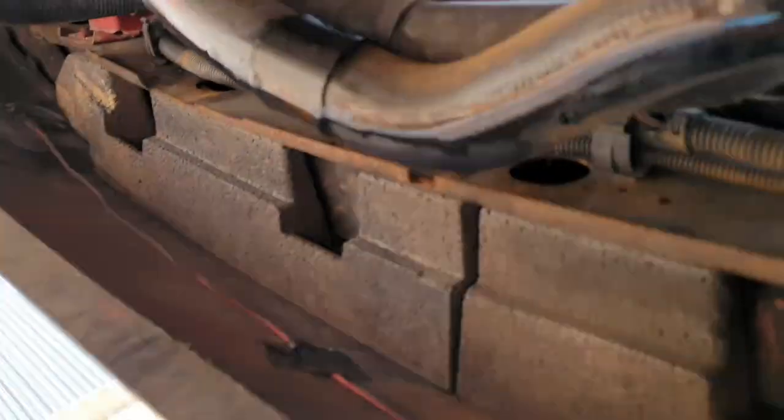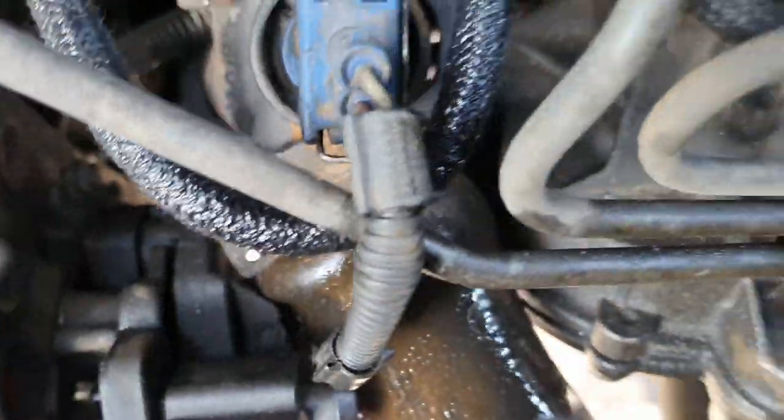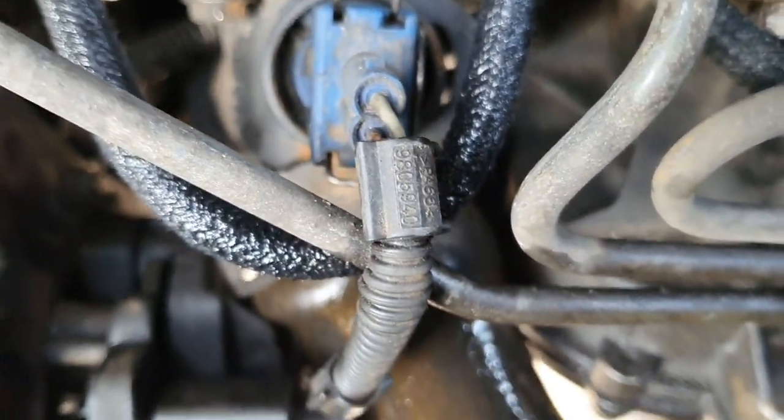I've got a nice little wet patch there, it's all wet up there. It's coming from that pipe — from one injector to the other — that pipe's leaking fuel. So I've also got a fuel leak. I'm about halfway through doing the DRLs, so the oil filler is fixed, but I still have another leak from somewhere.